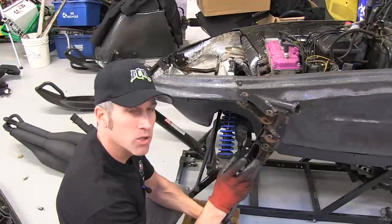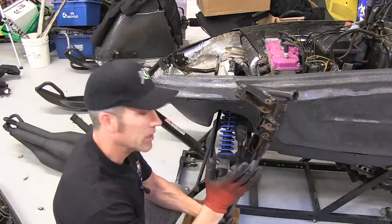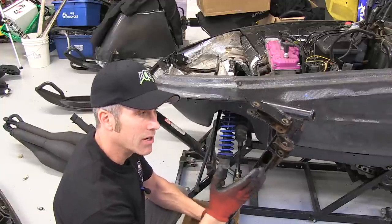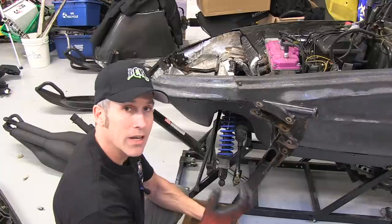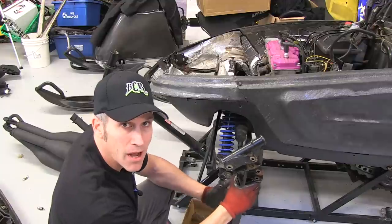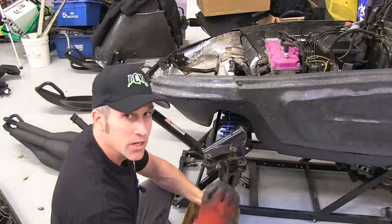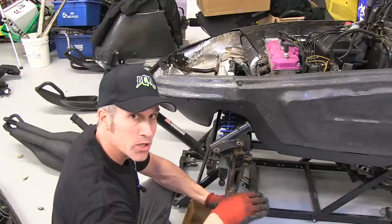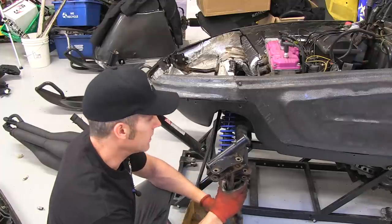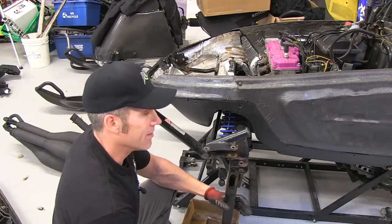One thing I want to tell you guys — I'm not sure if I showed you this last time, but I did cut off the sway bar. It does lighten it up by about 5 to 7 pounds. But keep in mind that if you're on a trail, you're not going to have that sway bar to help you turn around the corner. I took it off because I'm mainly playing in the powder and I want that extra weight gone. But when I do hit the trails and go to turn, that front corner wants to dip down and I don't get the real cornering like I should. So if you want to play on the trails, don't cut the sway bar off.